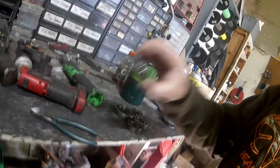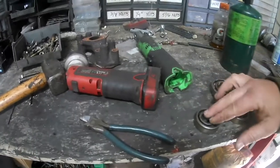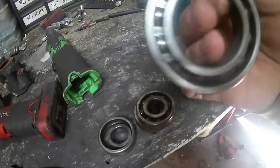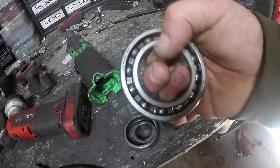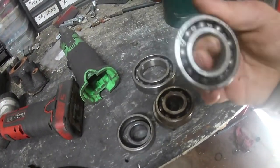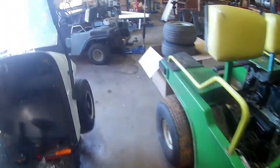On the input shaft on the inner side, it had just completely lost the balls and everything from inside of it. This is what happens when you don't have fluid in it. These bearings — you could probably clean them up, stick them in a parts washer, try to get the grit out that's built up between the two races and the balls, and then put some assembly lube in it. But in this case, this golf cart is used at our local industrial park businesses, so we went ahead and split it apart.